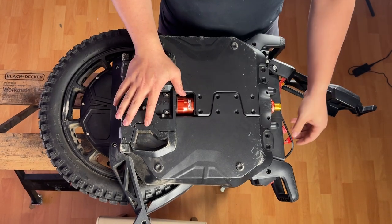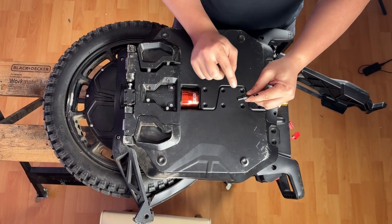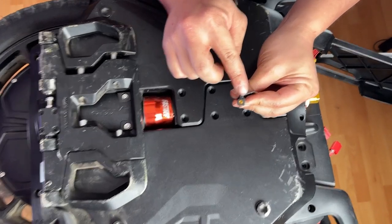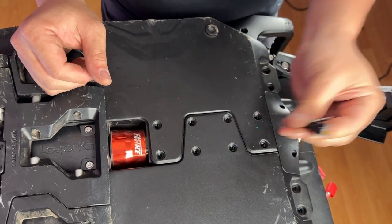At this point you'll need to be very careful about your battery cables. On the control board holder there are recesses, and on the battery cable there is a small extra piece. You'll want to rotate this cable so that the small piece is facing towards you — that will allow you to remove the battery cable from the control board holder area.